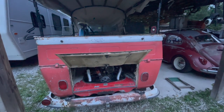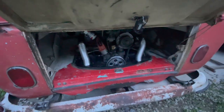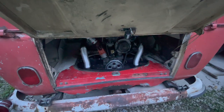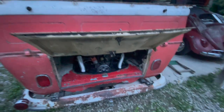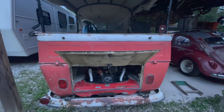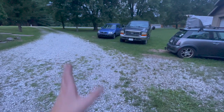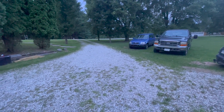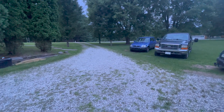You know. And when I cleaned everything up in here, I did actually loosen the hose clamps and look at everything, and it looked fine, but they are definitely split somewhere. So it's sucking air and it's not going to run correctly. The funny thing is it sat right here and ran really well. Bummer. And it ran up the driveway. Fantastic. Ran out the road. Great. I was like, man, this thing's running fantastic. Gotta love it.